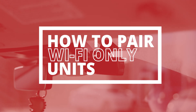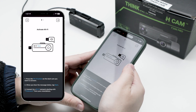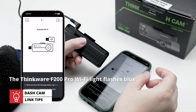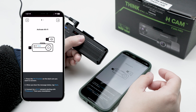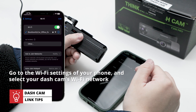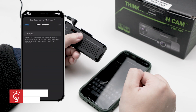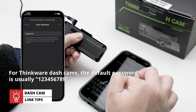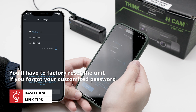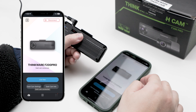If you have a basic Wi-Fi only Thinkware dashcam like the F200 Pro, the instructions are a bit different. Same as the Bluetooth models, the first thing you'll need is to download the app, give it the necessary permissions, and select your camera model. Then tap the Wi-Fi button on your dashcam. The camera's Wi-Fi light should flash green, and the unit should give out Wi-Fi connection instructions. On your smartphone, connect to a Wi-Fi network whose name starts with Thinkware. Go to the Wi-Fi settings of your phone and select your dashcam's Wi-Fi network from the list — this network name is typically prefixed with Thinkware followed by a series of alphanumeric characters. Once you tap on your dashcam's network, the app will prompt you to enter the password. For Thinkware dashcams, the default password is usually 1234567890. However, if you changed the password previously, use your customized password. You can technically reset the password if you forget, but you'll have to factory reset the unit. Once done and the phone is connected to the Wi-Fi network, return to the Thinkware Dashcam Link app and it should connect automatically.